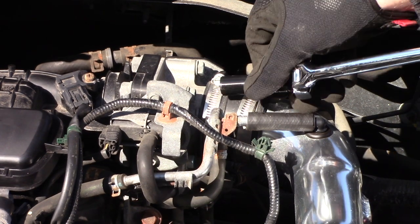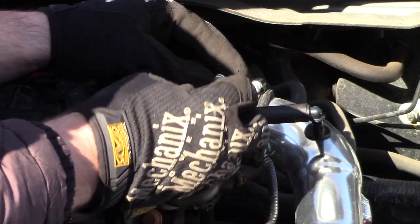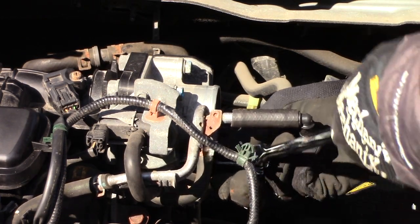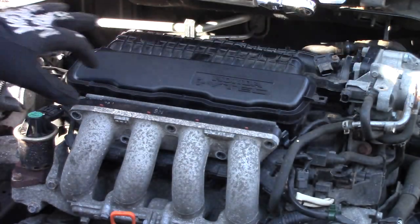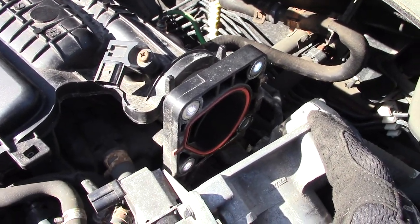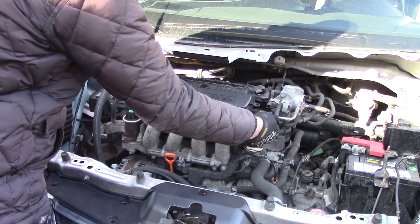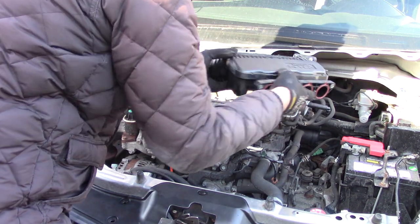The bolts on the throttle body are also 12 millimeter. I'm going to loosen up the hose clamps to make sure that removing the throttle body is easy, and I'll loosen up the intake as well just to have it move around and get additional clearance. With the intake out of the way, don't forget there are two more 12 mm bolts on the bottom of the throttle body. After loosening all four throttle body bolts, this bracket simply pulls up. The manifold is still attached — there's another 12 mm bolt down here and two 10 mm bolts on this perch. Once those extra bolts are removed, you can move the throttle body to the side and simply lift and move the whole entire intake plenum out of the way.